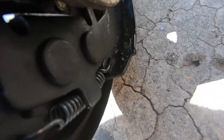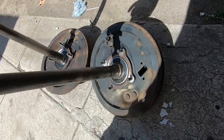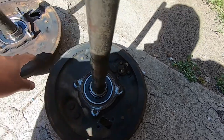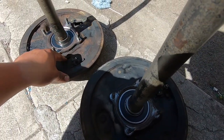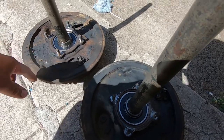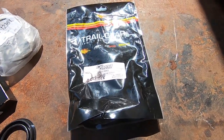You can see there's some oil right there. Now we just gotta get these pressed out and we'll be ready to throw it back in. One of these little caps is missing on this side so we have to find one of those. The brakes are going to get replaced entirely, so we're not too worried about that — we're just getting ready to press the bearings out.